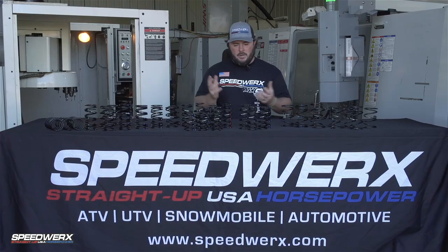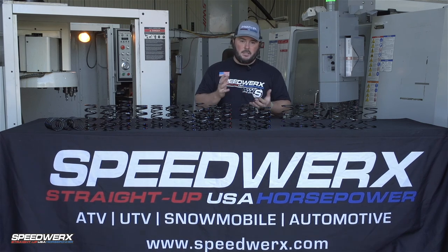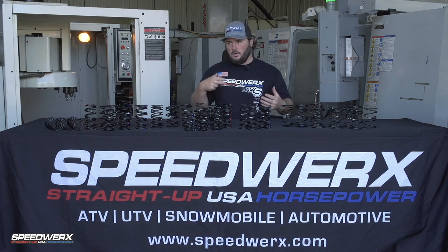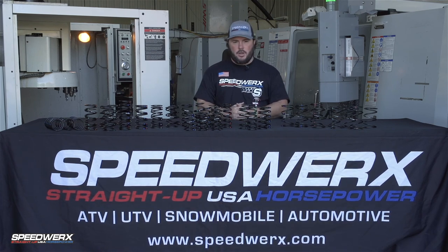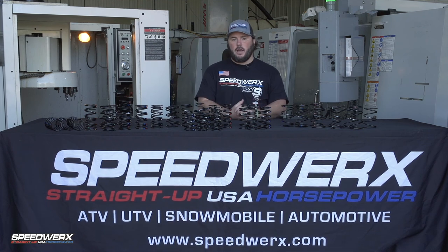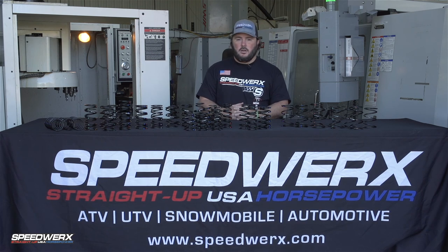The heat they see and everything that goes into it makes these parts really hard to make so that they last long and perform consistently year in and year out. A lot of guys overlook this — they'll have a sled for three or four years and they've never changed clutch springs. Unless you run H5 springs, clutch springs need to be replaced probably more than once a year.